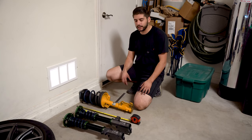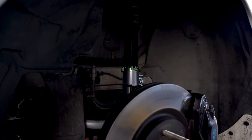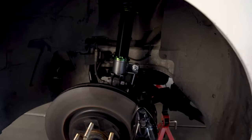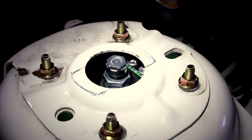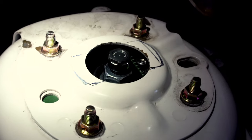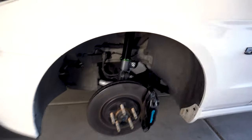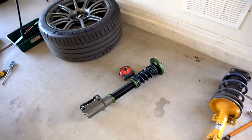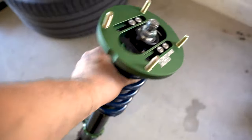We're going to drop this Fortune Auto coilover in the car and see how it looks. We got the coilover all set in place, but we forgot to set the camber. The camber is right under the top hats and is unable to be reached while the coilover is on the car. Most cars have the top hat cut out enough to adjust camber while it's on the car, but unfortunately the Mustangs are not cut out enough for the Fortune Auto coilovers. So before you put the coilovers in the car, make sure your camber adjustments at the top are set and all those allen keys are locked in place before the coilover is installed.